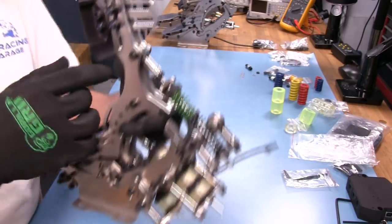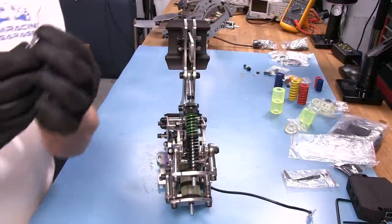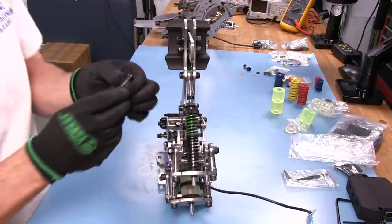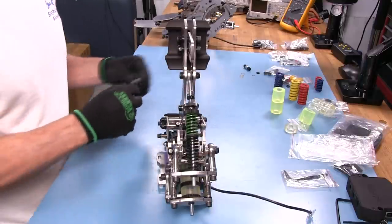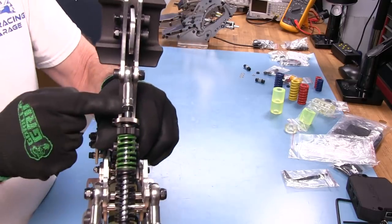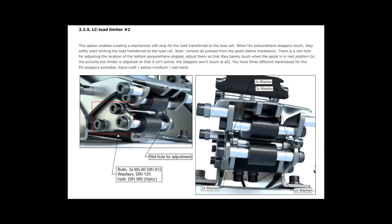We did have to take the spacer out up here, and it was this guy. Got two bolts on either way, and of course it fit right in between our 4mm stainless steel pieces there, but we took that out so we could put the rod end on the other end of our preload spring in there. Now there's another one, I'll show you something about that, that is a piece that actually came on the brake pedal when I got it.